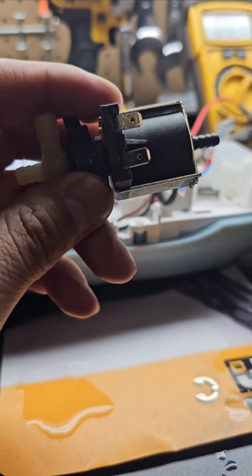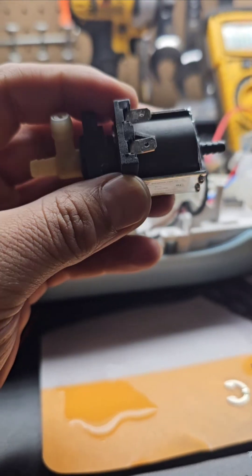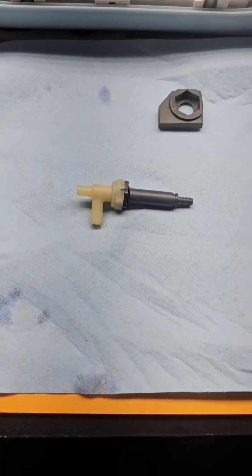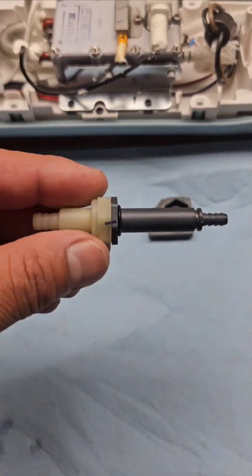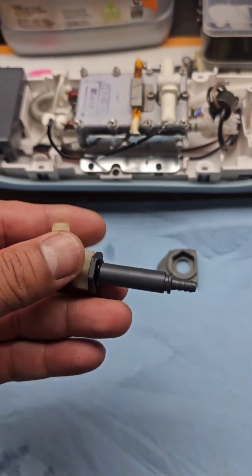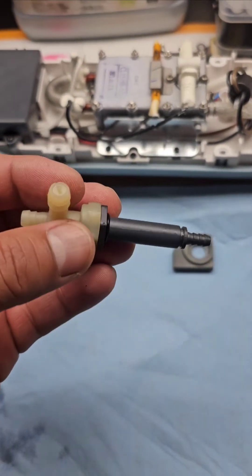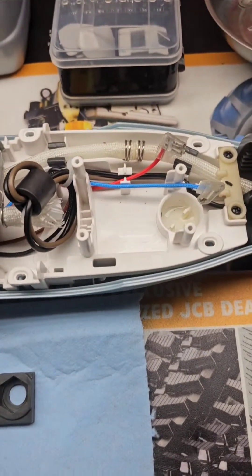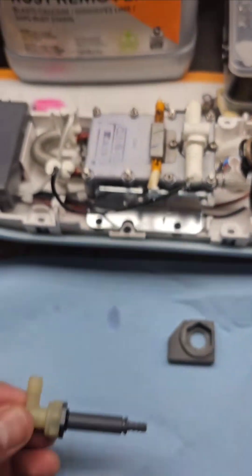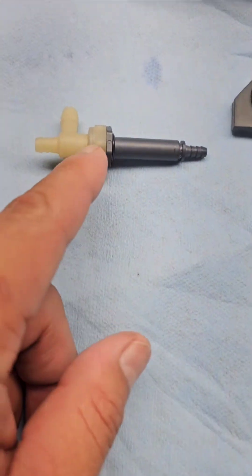I don't think this is bad. I checked the ohms on it - there's continuity, it's not open. So this coil is still good. I was thinking about this and it occurred to me that maybe this thing might just be dirty. Because we have hard water where I live and I got this from one of my neighbors. So what if this is just plugged up with water deposits? I took it all apart and took this out - I'm actually going to dip it in some CLR. But first I'm actually going to open this up and see if maybe it's dirty on the inside.